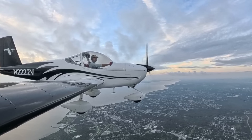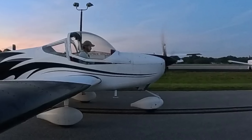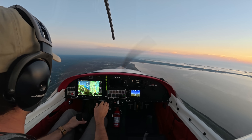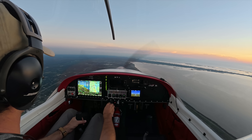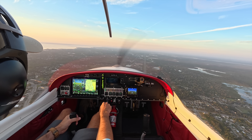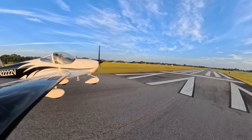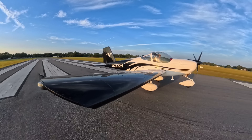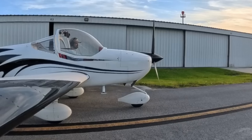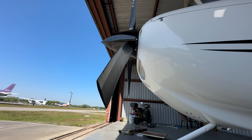The main reason I decided to try the E-Prop was the overall smoothness in flight. The Rotax 912 ULS is a geared engine, which makes it sensitive to vibrations — more vibration equals more wear on the gearbox. The difference is night and day compared to the two-bladed propeller. Some days it runs so smooth you'd find it hard to believe you were flying behind a piston engine. When shutting down the engine, my old two-blade would shudder throughout the airframe, and I just knew this would eat the gearbox over time. The E-Prop removed a significant amount of vibration, especially on shutdown. So yes, the E-Prop is a game changer for cruise speed, reduction in weight, and overall buttery smoothness. But here are some potential drawbacks.